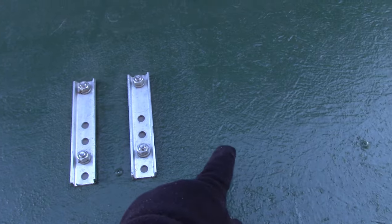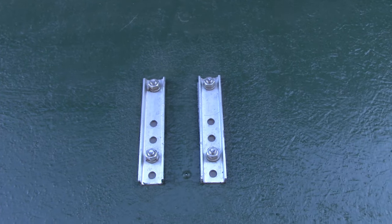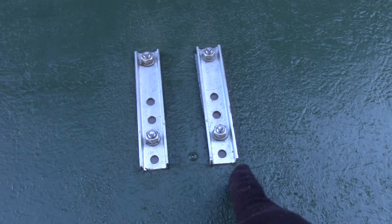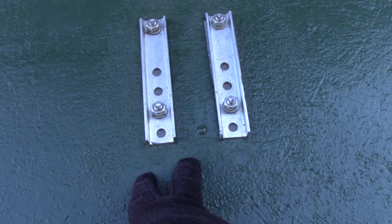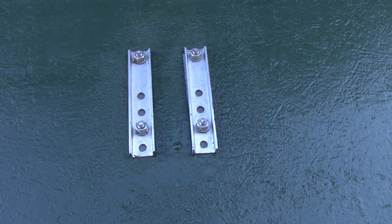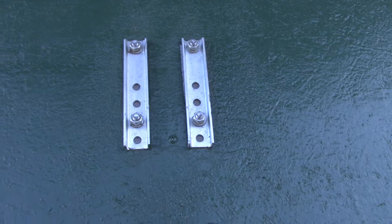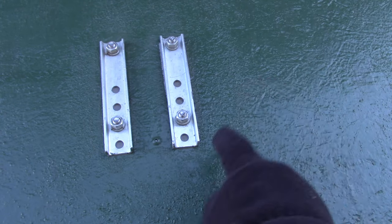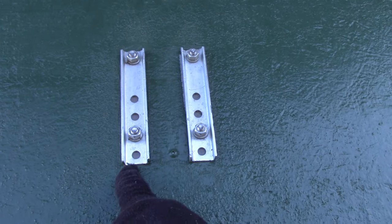These are one-and-a-half-inch frames inside — in other words, there's a one-and-a-half-inch space between this plywood, or OSB, and the skin on the outside of the trailer. So what I did was, because it's one and a half inch, I glued in a short piece of 2x4 on either side of the frame. I just used construction adhesive and glued it to the outside skin, so I can still get this OSB board off if I have to. What that did was make it so that these bolts couldn't compress the plywood and the skin on the outside.